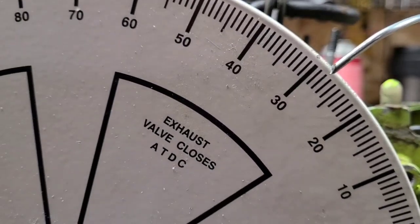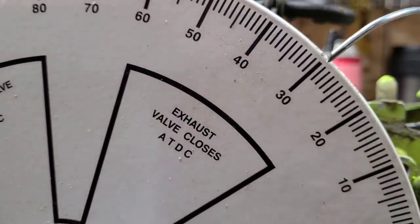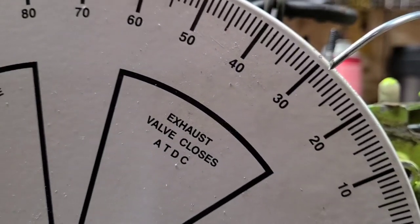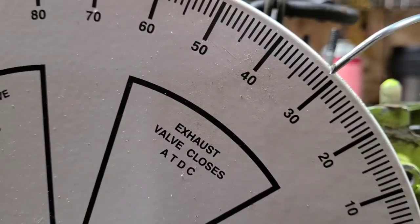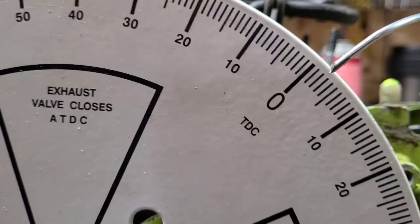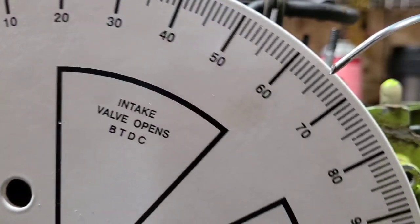Okay, now, if you look at the timing specs, go to Akers, the Mike Akers site. That's the one with all the specs on all these saws. Invaluable. It'll tell you when the spark plug fires. A lot of them it's 30 or 25 degrees before top dead center. Okay, so say it fires there. We go around, top dead center. Now the piston is going down.